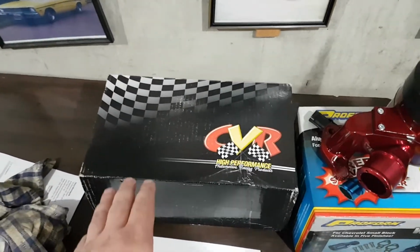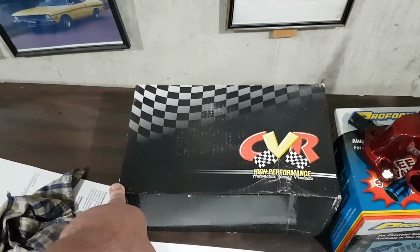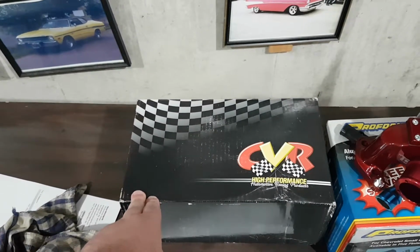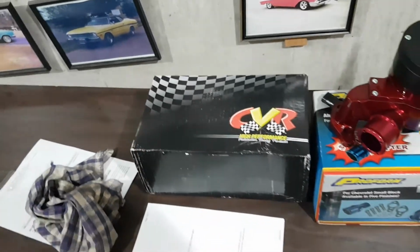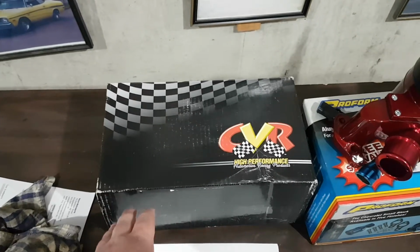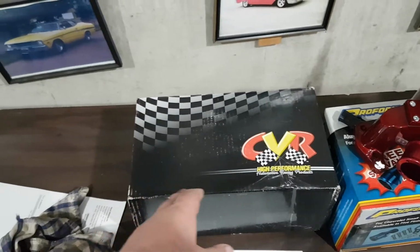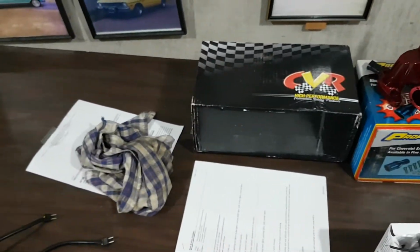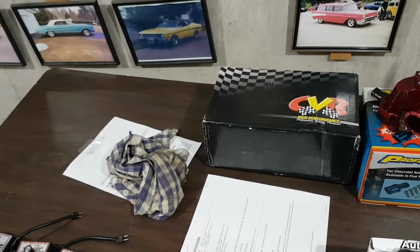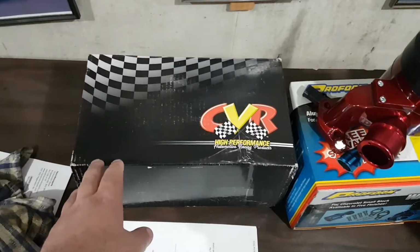I'm not sure which one he has in his buddy Tony's car. This here is the vane style. It's more expensive, but I like it because of the noise. This vane style is more the sound of an electric fuel pump. It's quite quiet, whereas the cheaper diaphragm ones sound like those 12-volt air compressors. They're real noisy.